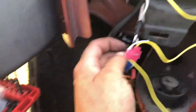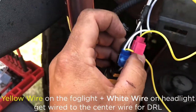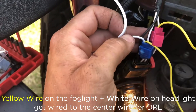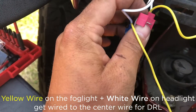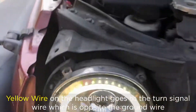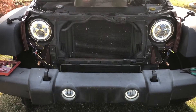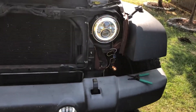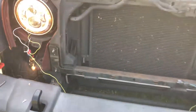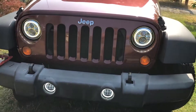What I found is that you need to take the yellow wire from the fog light and put it into the middle, along with the white wire from the headlights into the middle, and then it will work for daylight run lights. This other yellow one from the headlights is the blinker, so we can test the blinker real quick. When I turn on the emergency signals it will force them on — and here we go, we are getting the amber showing through, so that is what that looks like. Everything is reassembled now and we're good to go.